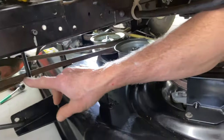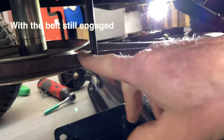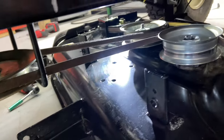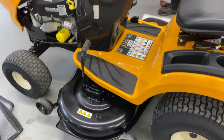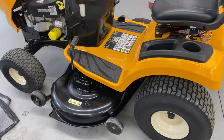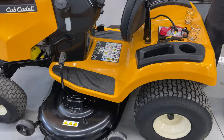Put the bolt back in and tighten it up. You want to look below and make sure that your mower deck belt is not rubbing on either side, and also make sure the guide is not running on the engine pulley. Now we can go ahead and disengage it so it can run, then engage the mower deck and bring the mower deck up halfway. At this point I'm going to go ahead and adjust the tire pressure. You want to take it out for a test drive — I'm going to run the mower and then bring it back in and level the mower deck.